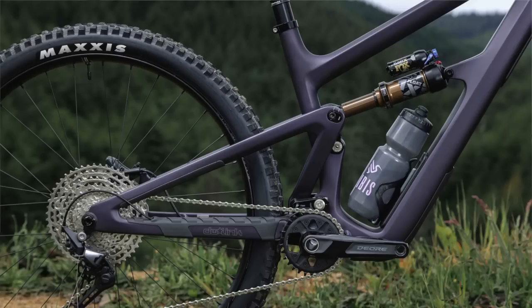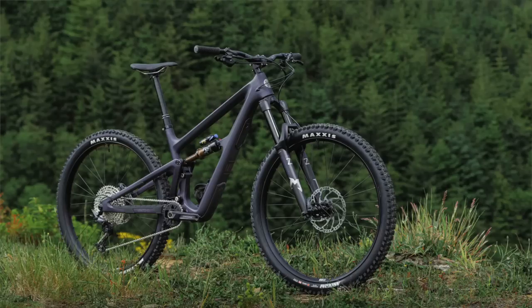Not only is there axle movement, but because we're adjusting seat tube angles per size we're moving the rider's center of gravity forward on the larger bikes, so the chainstays don't have to be so long. Seat tube angle is a much more effective way to balance the rider's mass than chainstay length — if you really wanted to balance reach with chainstay length, you'd have to make the chainstays longer by the same amount as reach per size, putting the XL chainstay somewhere in the 500s. Instead, you can move the seat tube angle a degree and achieve the same thing. We do a little seat tube angle, a little chainstay, and get it all to work within a range that makes a fun bike.